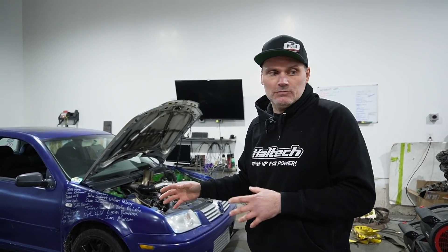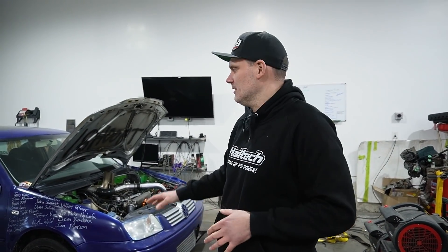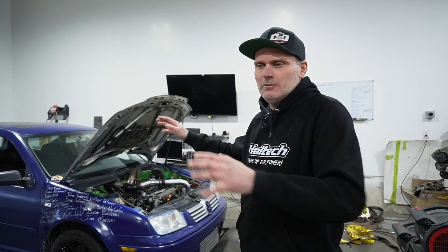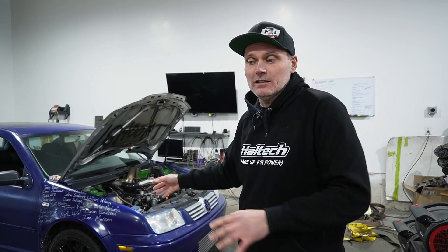Just like my drag car transmission — which is over there — that's an O2J transmission. They can handle a lot of power with lots of modifications. But a stock transmission like this, it's not gonna hold. I literally would launch the car — I might be able to slip the clutch really far, but there's not gonna be any record-breaking quarter-mile times with this car and a stock transmission. Most likely the transmission would be left on the ground at the starting line.